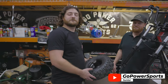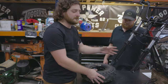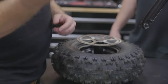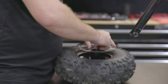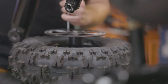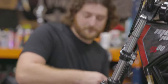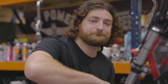Helping me today is Junior. So we are going to mount the brake disc on the opposite side of the valve stem just for easier access. Six hole brake disc. The head on those can strip out pretty easy, so we are going to hand start all of these and do them as much by hand as we can before we start getting a tool out and going after them. These are four millimeter. The reason we're using these button head screws is because the head is short. If we did a normal bolt, the head would end up hitting the inside of the fork — that's a good tip.